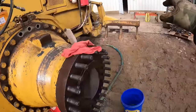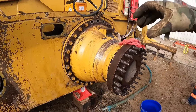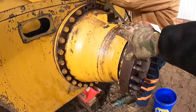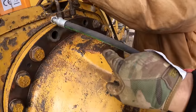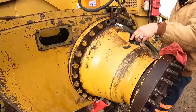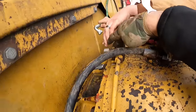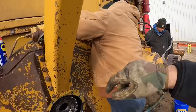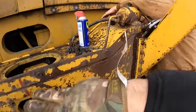What we're going to do is get those chains set in these tandems, but we need these to rotate. Since the brakes are hydraulically actuated, when they're off they're set to on - so when the machine is off the brakes are set. We have a little foot pump that's going to go into this port to release this brake and allow us to roll the chains in. Actually we're going to take this foot pump to the back of this diversion block so we can get both brakes - if we just did that one it would only juice the one brake. We're going to hook the pump up to air and that's going to release these brakes.